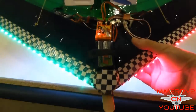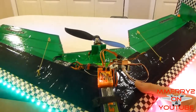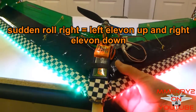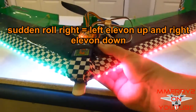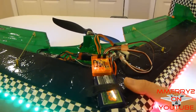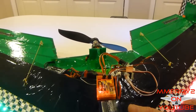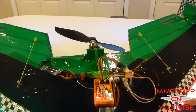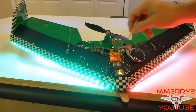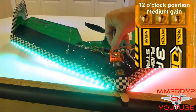Let's also check the roll movement. A sudden right roll should cause the left elevon to go up and the right one to go down. Mine works properly. If it moves in the opposite direction, first reverse the DIP switch for the aileron on the 3-axis gyro, then reverse the aileron channel on your radio. After you're done testing, turn the gyro gains back counterclockwise to the middle, or 12 o'clock position, for flight testing. Test with that setting and then slowly increase the gains after some test flying.